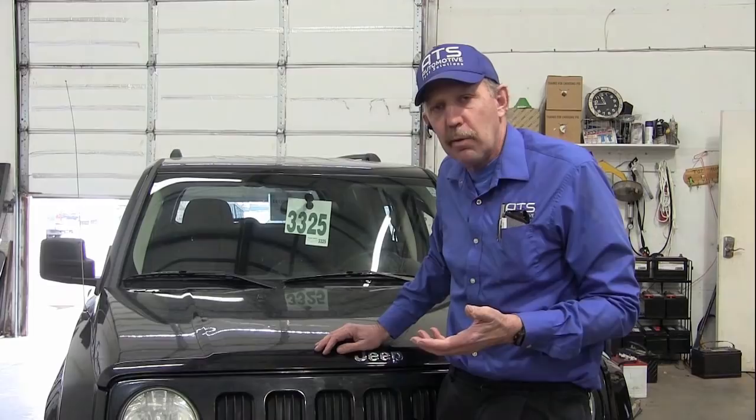I mean, let's look at this car. This car has a new crank sensor in it. The pigtail from the crank sensor has been cut and spliced into the harness. It's got a new PCM. The coils and plugs were replaced. And I don't even know what else, but at least those, I can see all that done. There's probably been more. And the dealer wanted to put the entire harness on the car.